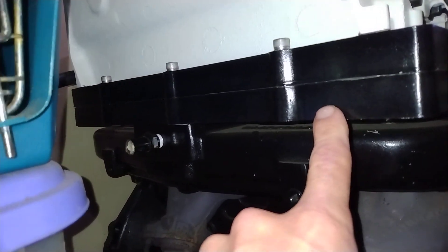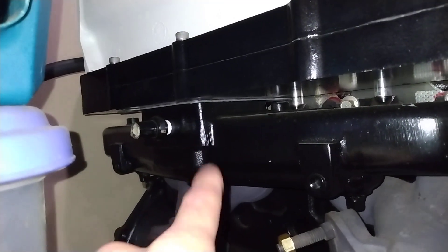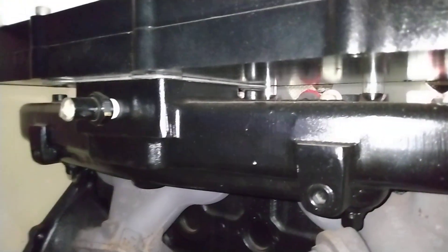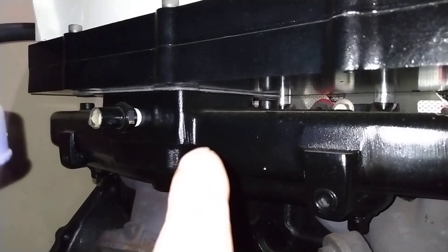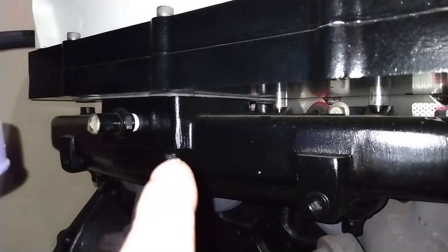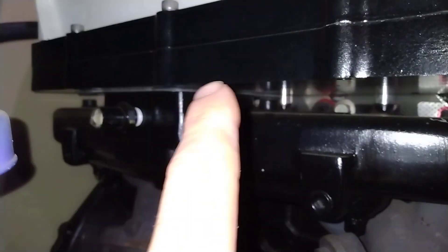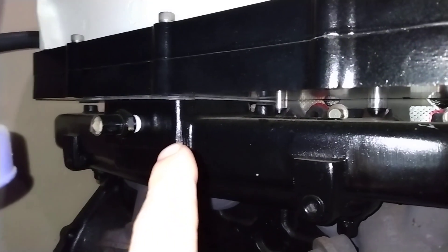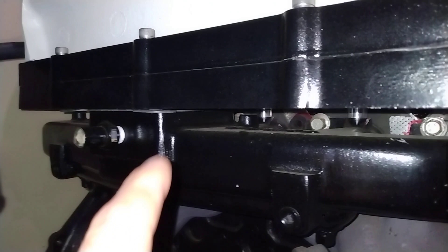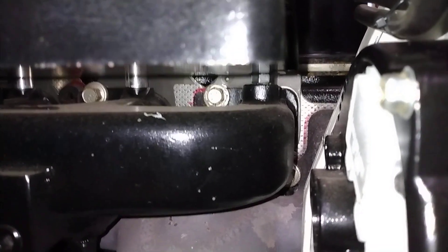Basically, we have the Clifford without the adapter — either manifold should be about the same. In this lower match plate there are no holes except matched up to the opening in the intake manifold. That lower plate gets bolted on with four bolts, and that is not a standard carburetor pattern — it's slightly smaller. So you put adapters on the Clifford intake manifold, and the only hole cut into this lower match plate — one-inch aluminum — is just the square opening, which is radiused a little bit for airflow.